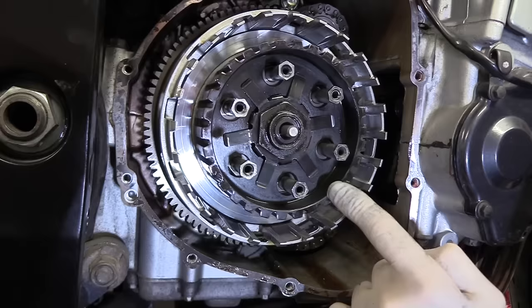However, when you put them together, if you put them together dry, then you'll never really get enough oil in between to impregnate that cork. So the cork itself will stay dry in parts. That means it will immediately overheat, and it will not only warp these, but then it generally will warp the steel plates as well. Again, if you're ever concerned about the steel plates, if you're worried about the warp, pop them on a sheet of glass, you can see straight away whether they're flat or not. But those are absolutely cool.